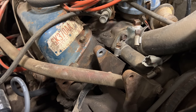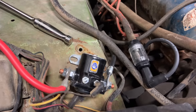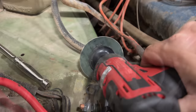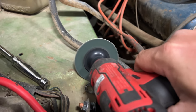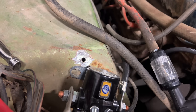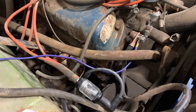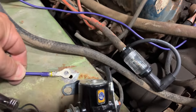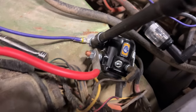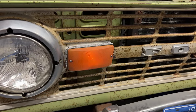I have my bolt over here removed and that's all cleaned up. Over here on the solenoid, that's where I'm going to put the other end of the ground, so I need to take my grinder and just clean that up a little bit. Now we have a good contact patch for that body ground. It's going to come along the purple wire and then over to here, and all of this will be screwed together. And our turn signal is now flashing again.